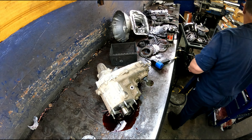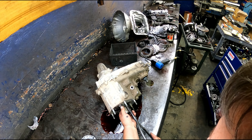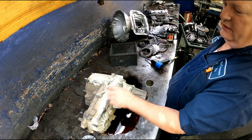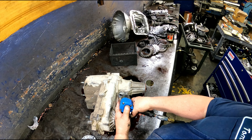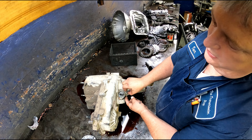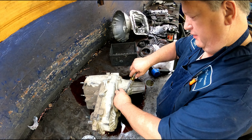There's a snap ring on the front here. Ten millimeter 12-point — these here are 10 millimeters, these are 15s, and the rest are 15s. That one's going to be right in the way. 13 millimeter for the speedometer. We need to pay attention to how it's turned — there is a way to tell which way it goes, but to make it quicker we can just pay attention to how it's in there and put it back that way.